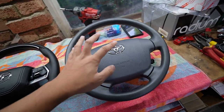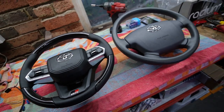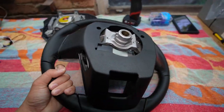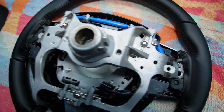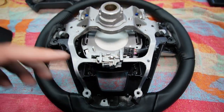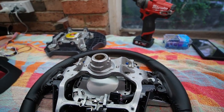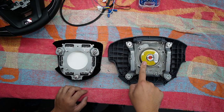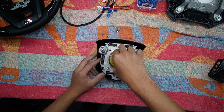This morning we're going to complete our steering wheel install. Yesterday we removed the stock steering wheel, upgraded the clock spring, and made a steering wheel control harness. What's left is to move the factory detonator from this horn pad over to the new horn pad. Take off the horn pad — you need to remove the backing plate since the wheel is not on the car yet. Looking at the steering wheel from the back, you can see where the horn pad is locked in: one tab there, one tab there, and one tab there. Since the wheel is off the car, it's a lot easier. Push to unlock and get the last one at the base. So on the back of the horn pad, we just need to move the detonator over — it's just an 8mm nut. Transfer that over in the same orientation, straight to the new horn pad.